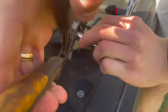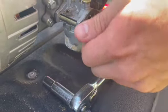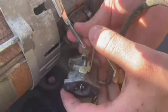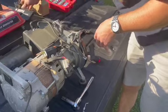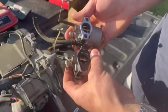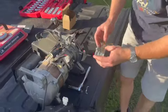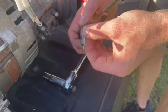You get the nuts to lock together and just back it off — your stud comes out. I already loosened this one up for proof of concept before we turned the camera on. Now if you take your studs off, you curl this — we're going to pop the spring off — and your spring comes off and your linkage comes off. It's always a good idea to compare your carburetors. This new one is a little bit more universal, but it looks like they're going to work pretty well. We're just going to put this on, hook our linkage on, and the spring.